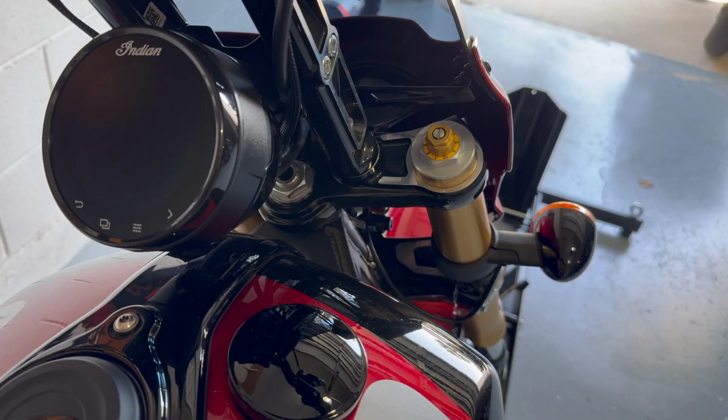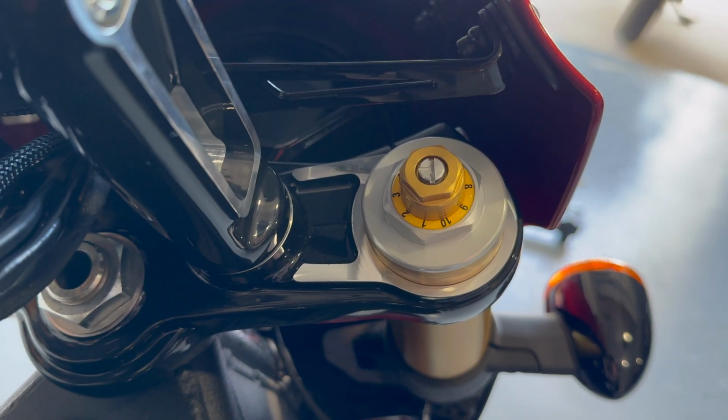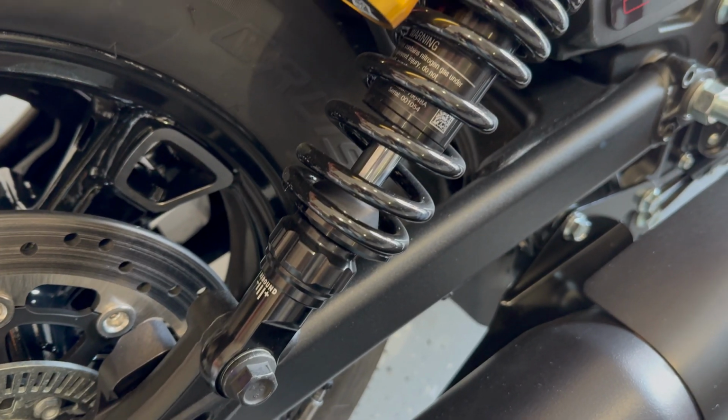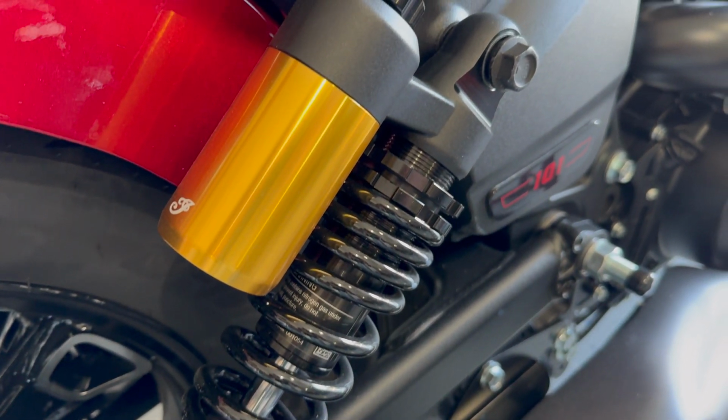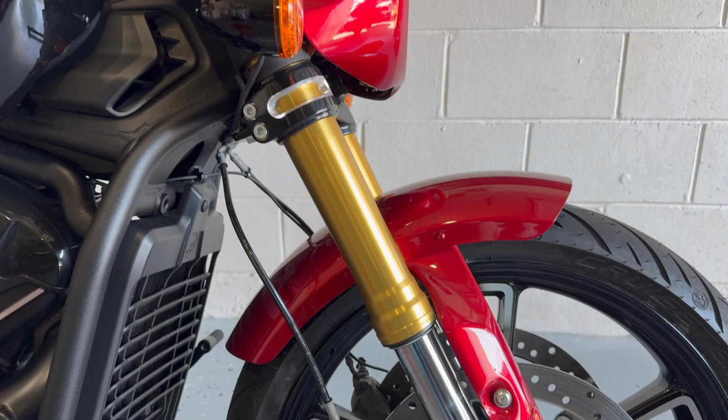I would always write down how many turns from open that you're putting onto the bike. Just throw that in your phone. That way you've always got it with you, you know where you're at. If you ever lose those marks on there or you lose count, just wind it back to fully open again and start turning back from there. At least you know how many turns you're at last time, and you can do that same calculation again. When you're out there, rebound and compression are something that you want to dial in as you go. And I mentioned before about doing that one section of road. So pretty easy on the back, no tools needed. But if you just take your spanner and your screwdriver when you're out for a ride, you'll be able to dial those in as you go and just get it set up perfectly for you.